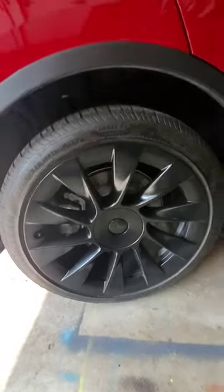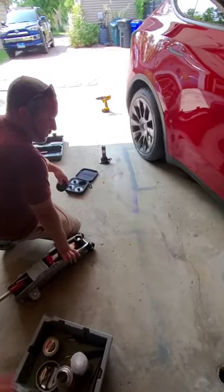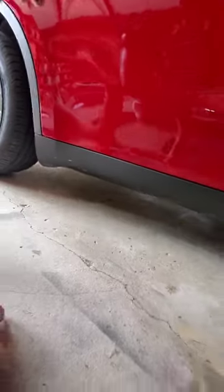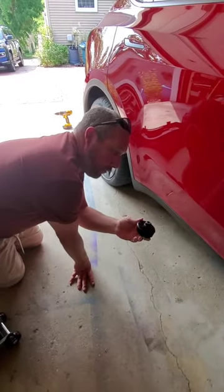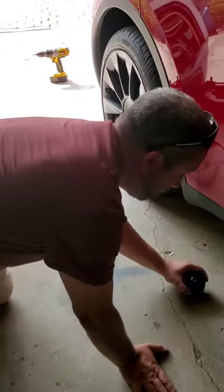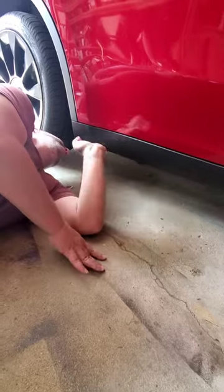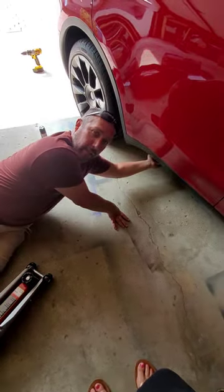We're going to have to jack the car up. There's a little hole in here that will make contact with the frame, and since the battery is right there, you've got to buy these special pucks — a set of four was like 20 bucks. You first get in there, stick it in that hole, it'll kind of click in, and that is where you're going to jack it up on that surface.